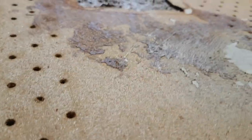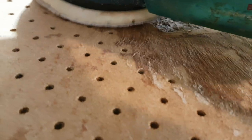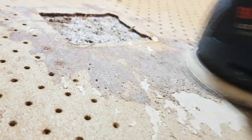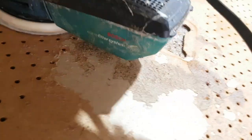I do suggest not adding any adhesives or glues to your roof lining underneath the fabric when it starts to sag, because it doesn't work — and this is what we're usually left with at the recovery stage. We've got all that glue compound to remove with a little sander, and not all headlinings can withstand sanding, so it can be a difficult process to get it nice and flat and clean. When the brand new material goes over, the finish only looks as good as the board underneath. Most bumps and lumps will come out as the car warms up, as the new foam and fabric expand and settle after a few warm days.